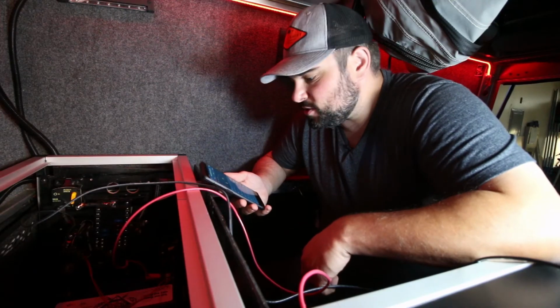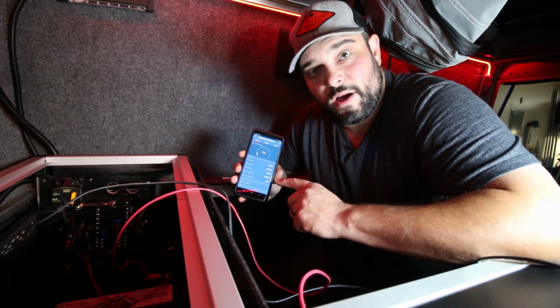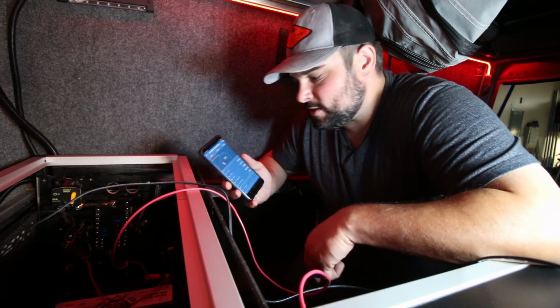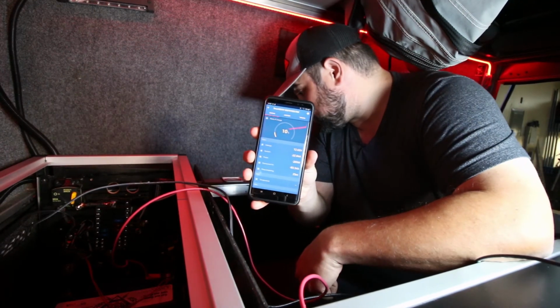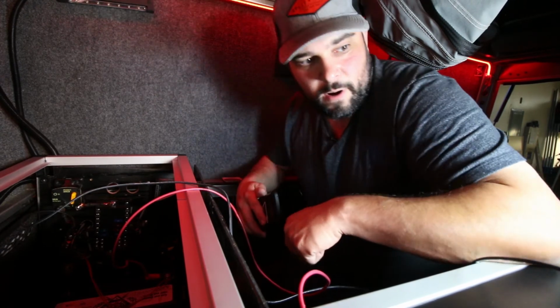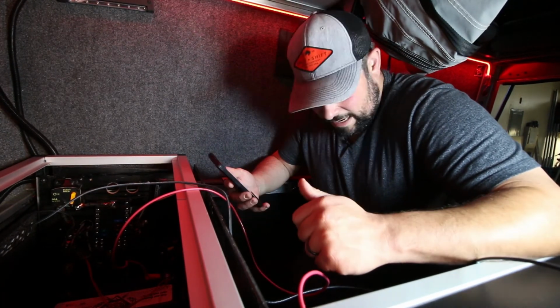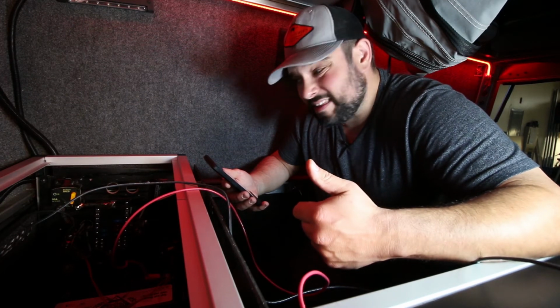I think that's pretty much confirmed. I think the battery is operating properly. We're down to 12.66 volts, still outputting 23.16 amps, almost down to 10% here. It's had alternating currents and draws on it for probably the past 4 hours, and it's pretty much performing and pulling down in line to where I think it really should be.